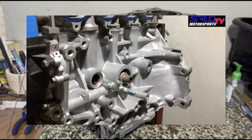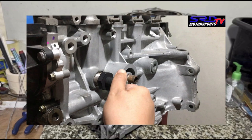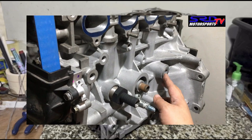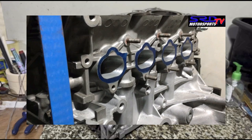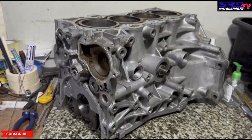The playlist at the end of this video will have all the B-series builds including all the episodes of this series. Here we go — we're putting the block fitting that we had custom made, but you can order this online and you can actually put two of them. Also on the VTEC block it has a breather box at the back, but that's mainly for positive crankcase ventilation, which works really well on idle.